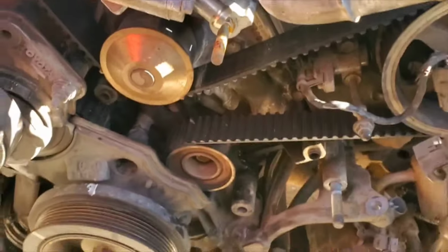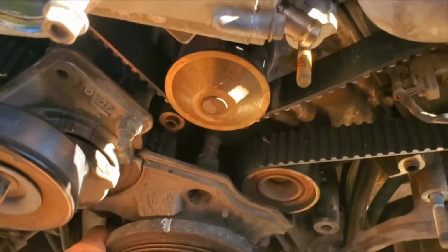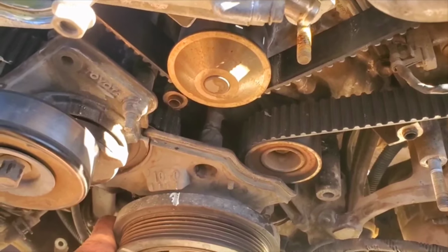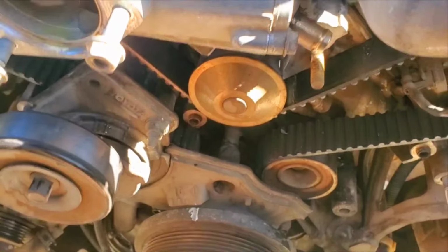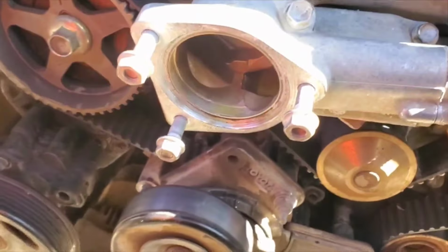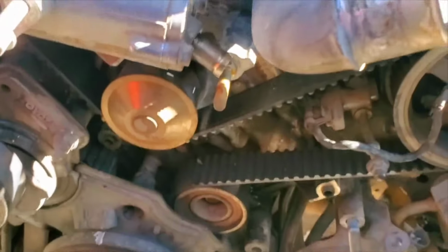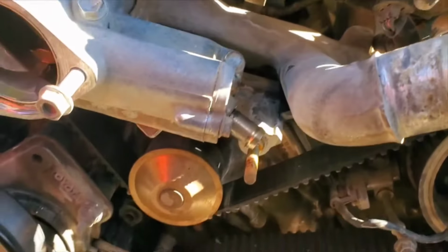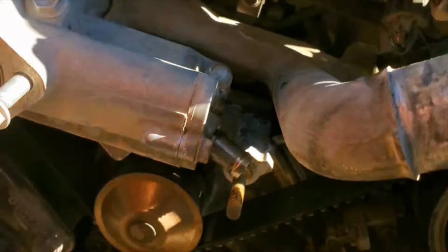Everything after that is all gonna be, I've got to dig out my impact, and I've already got my puller. That way I can knock this nut off, and then pull that crank dampener or damper and take that idler off, pull this off, and then I am at the guts of the situation. Then I can keep going, because the water pump is back in here.